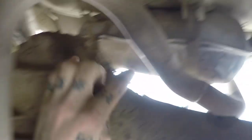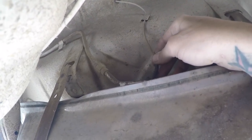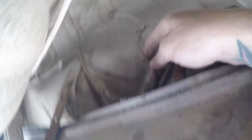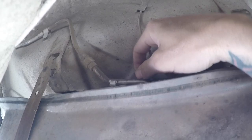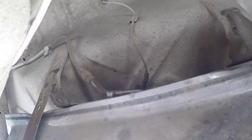What we're going to do now is reconnect the brown wire to the outside post on the passenger side and then inspect at the tank. Here we are back at the tank, just over the rear differential — you can see the tank behind the exhaust. We have the fuel line going up and out to the carburetor and we have the brown wire coming from the fuel gauge, looks like it pops through the floor in the trunk or rear seat area. There's a little nut holding this on, so we're going to take this off, ground it to a solid ground, and see what happens in the cab.